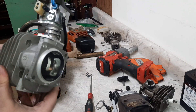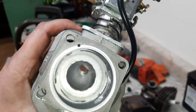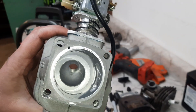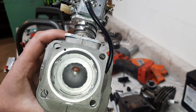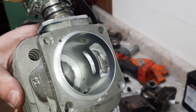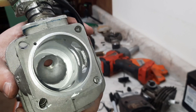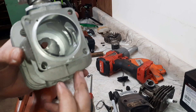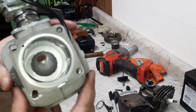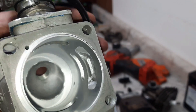We have a little bit to get caught up on, but here it is about ready to go on. Took sixty thousandths out of the chamber — still wasn't enough — put the gasket in and it ended up with about fifteen thousandths squish with the gasket. So I took ten thousandths off the top of the piston, so we'll be right at 25 thousandths squish. The first porting numbers were: 80 on the intake, 109 on the exhaust, 126 on the transfers. Where it sits now: raised the exhaust up to 100, 120 on the transfers, left the intake at 80.